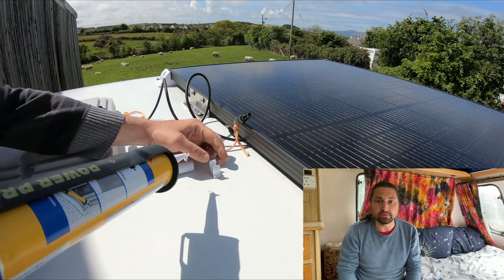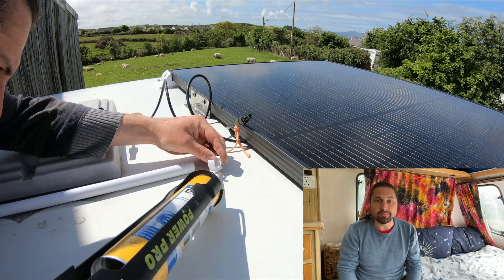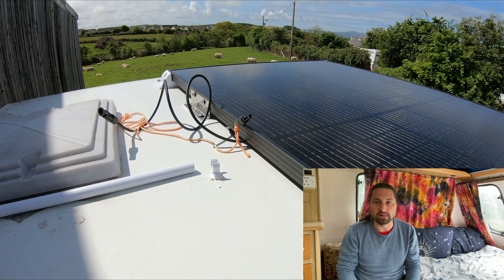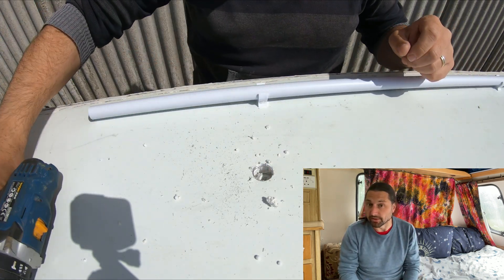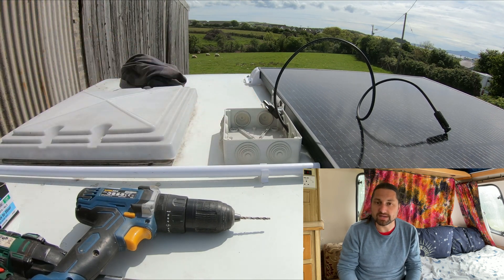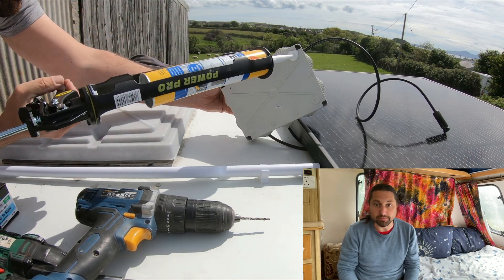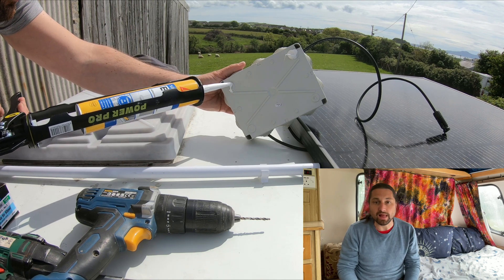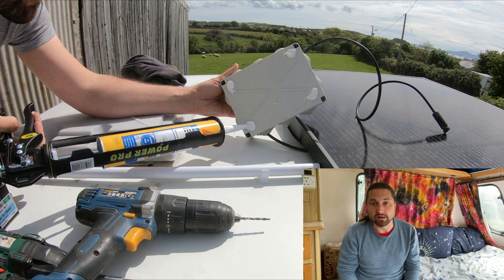I used an off cut of timber batten to give me lines that were square to the edge of the caravan as well as to the roof light. It was then a matter of running the conduit and installing saddle clips where required along the line. A 20mm hole was drilled into the roof to allow for cable entry — I had drilled it from inside the caravan first to get the correct location. I also decided to bring the cabling together into a waterproof junction box. The reason for this is that the tails from the underside of the solar panel were quite long with large black plugs on them, which would not slide into the 20mm conduit, meaning that if left out they would flap about in the wind whilst driving and be weakened by UV light over time.